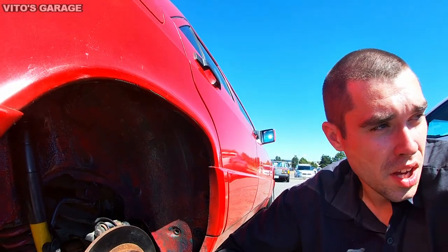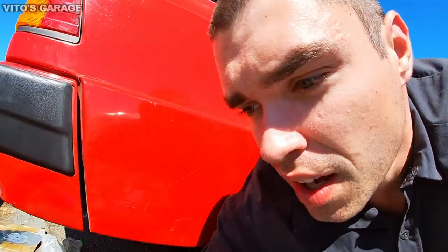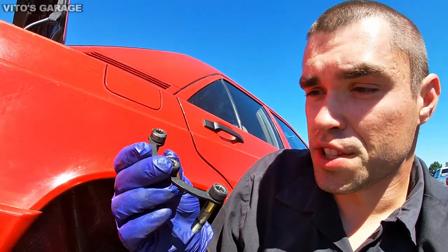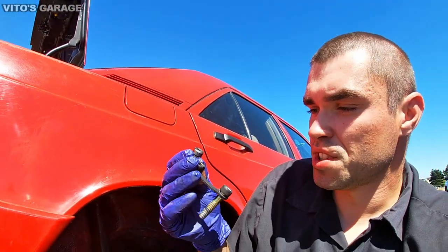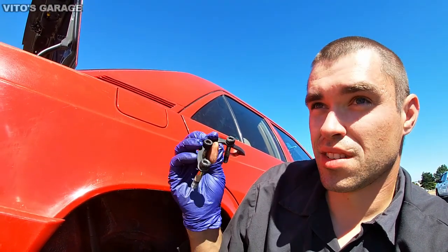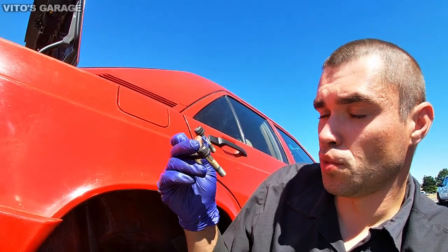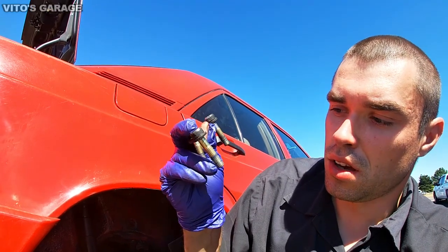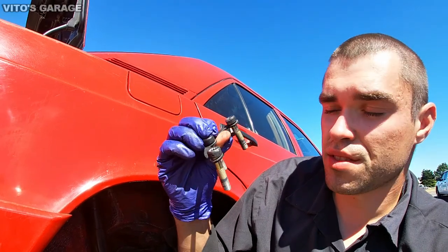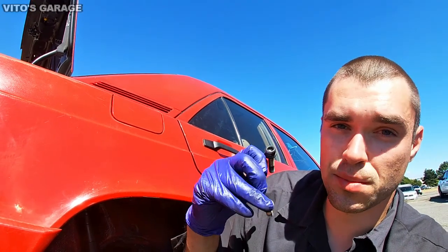And I'm about to put the axle back, and a couple more tips when you're putting the axle back. These are just half of the bolts for it, and they're all triple square, okay? So if you're doing a job like this on a Mercedes, you're going to need a triple square socket bit. I think it's a number 10. Before you reinstall these bolts, you have to put some blue thread locker on all these bolts, just in case.